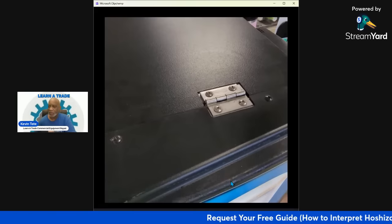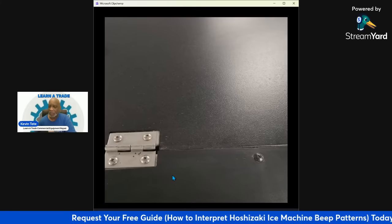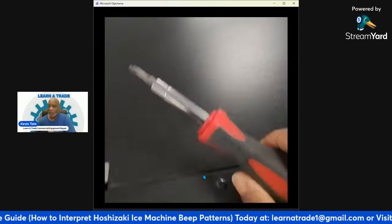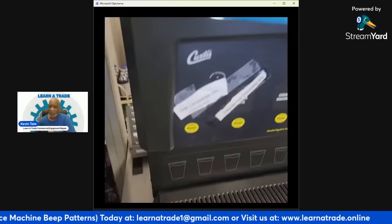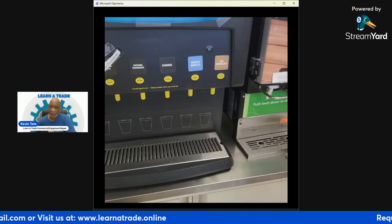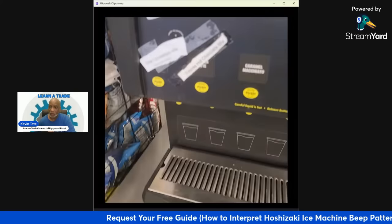And during this time, this unit is still heating. And like I said, it's a 3.5 gallon water tank. So if you ever are on site and you have one of these that needs to be reheated, just remember that it takes hours for those to heat up. I would say close to an hour and a half, 2 hours sometimes, for those to heat up properly.